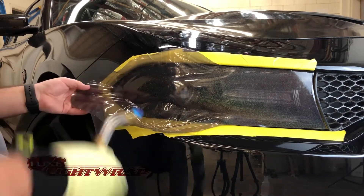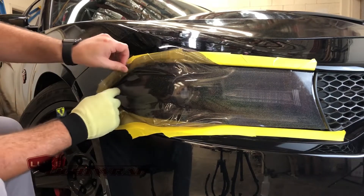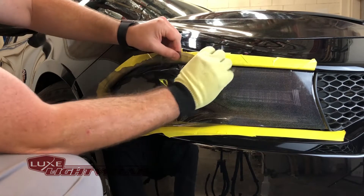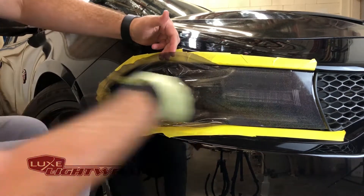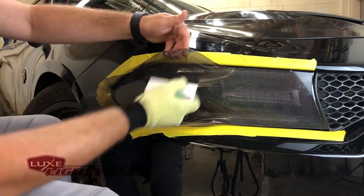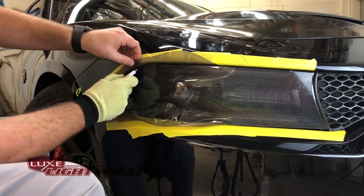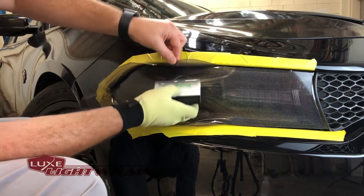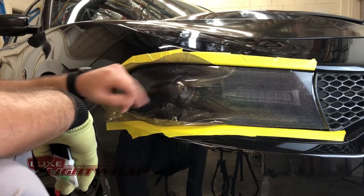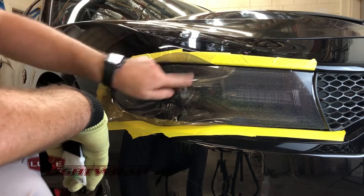Got a little bit of crease right here — put some heat and watch it disappear. Go ahead and apply the rest of the vinyl. I'm working it to where the only thing I have left to do is the bottom and the top. Now let's show you the memory effect of this vinyl. You can see here at the top flap I've got it stretched this way. If I apply heat, see how it naturally shrinks back to the shortest distance between here and here, which happens to be at the top edge. So I can simply grab the squeegee and help the vinyl lay down up there. You can see up here we have no tension marks — there's no stretch really applied at that very top edge. We're using the memory effect to actually help this lay down long term. If you see a whole bunch of little fingers in this direction after your first shot, you didn't pull enough horizontally — so pull more horizontally and you should have no tension lines, no fingers up here.